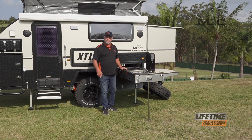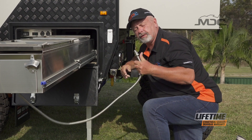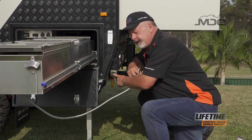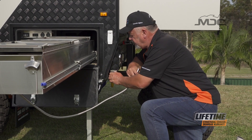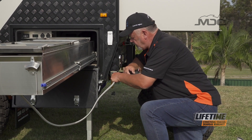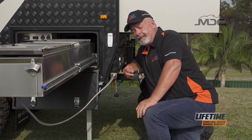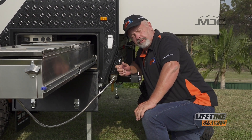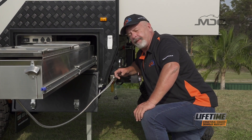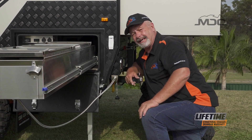The only thing we need to do is connect up the gas. The gas connects via a bayonet fitting, not dissimilar to what you would have on your gas heater at home. The bayonet receiver is here at the back of the caravan. Just take the little black dust cup out, line up the grooves on the side, push it in, and turn it to the right — it's now connected. My tip is: don't turn the gas on at the bottle before you connect this, because it'll put pressure at the back of the receiver, which will make it more difficult to push the bayonet in.